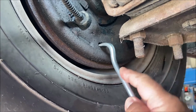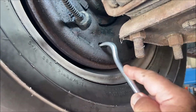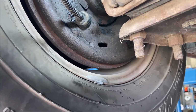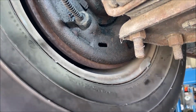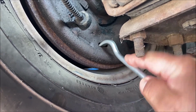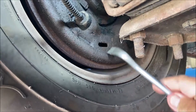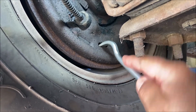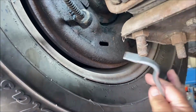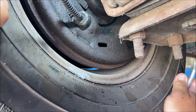Now you go in between the axle. You're gonna feel the axle drag, and you go to that spot in between. That's when you're feeling the brakes. Take it around, go in that spot in between the axle play. Now I'm gonna take it all the way down. Oh, it's dragging now, yeah. See, a little bit, now it's not dragging, see? That's what happens. Now there's no self-adjuster. Yeah, it's really dragging now. There's no self-adjuster, so we don't have to worry about that. Okay, there we go, now it's locked.